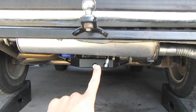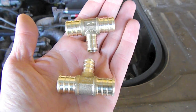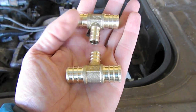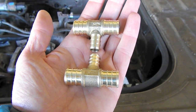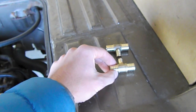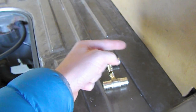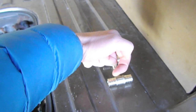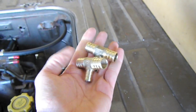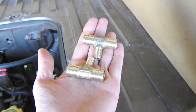Next up, we're going to put in these T's in the heater circuit — the coolant heater circuit. What this is going to allow is a bypass in case all the heater valves are closed. Heater flow comes through this way out to the heater cores; if both valves are closed, fluid can come down through here and go back to the thermostat housing so the thermostat can get the correct signal to open at around 78°C.